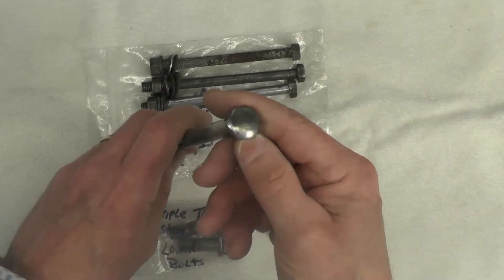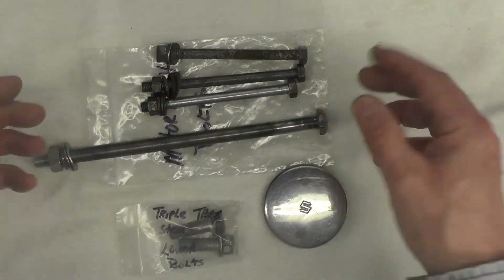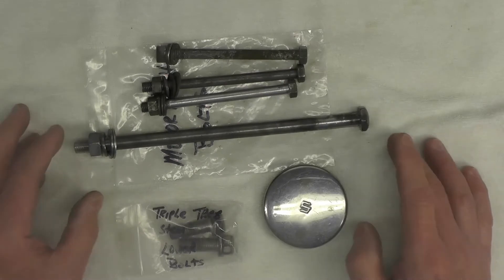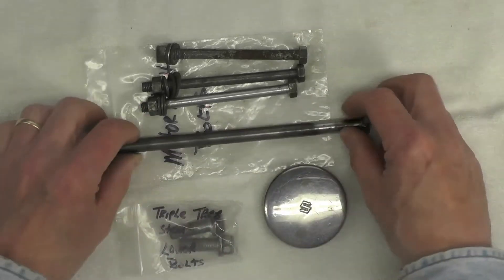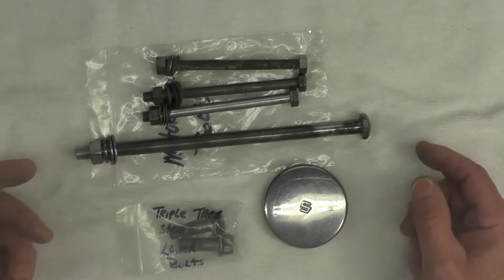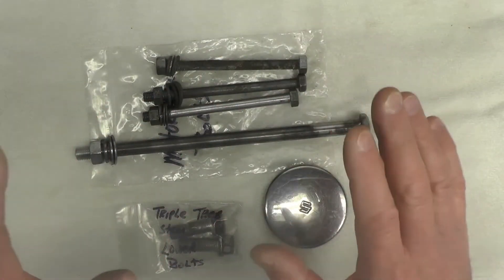All of these fasteners are in pretty good shape. They don't really indicate any tool marks — that is, hammer marks. Quite often, backyard mechanics will take a framing hammer and pound on motor mount bolts, marring and gouging them, or use vice grips on the nuts and damage them. These fasteners don't exhibit any of that damage, which is another reason I'm going to try to preserve them. At least one of the motor mount bolts was removed at one time, as it was installed backwards from what Suzuki originally intended, but nonetheless, these are all in pretty good condition.